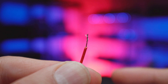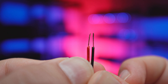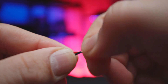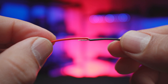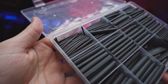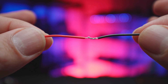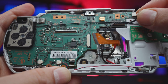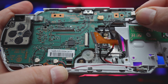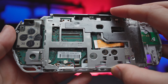Once stripped you'll usually have a frayed wire, so make sure it's tight by twisting it. There are two ways to combine the wires: you can twist them together for a nice tight solid connection, but it will look ugly, so I recommend folding it onto itself before insulating with small shrink tube or kapton tape. Keep in mind this wire will be sandwiched between the ribbon cable and the UMD drive itself, so you want the least amount of material in this area to allow the UMD drive to move freely once fully closed.